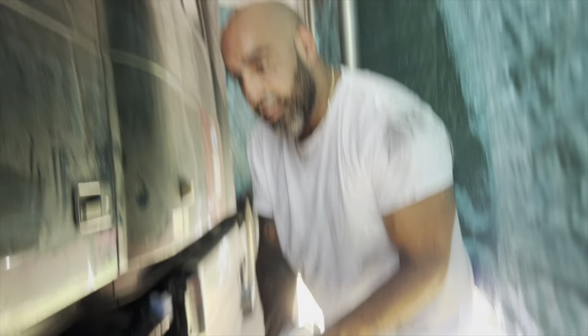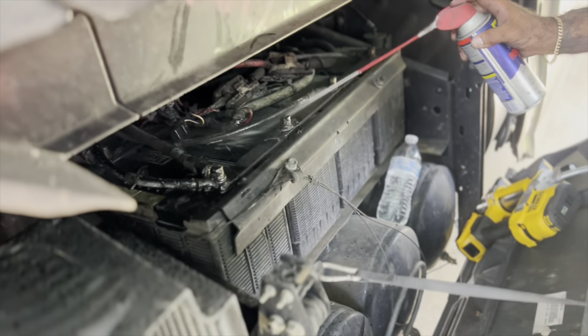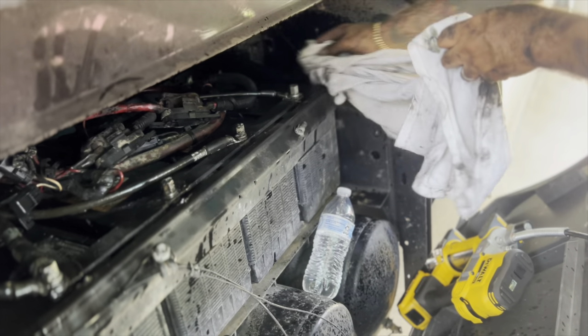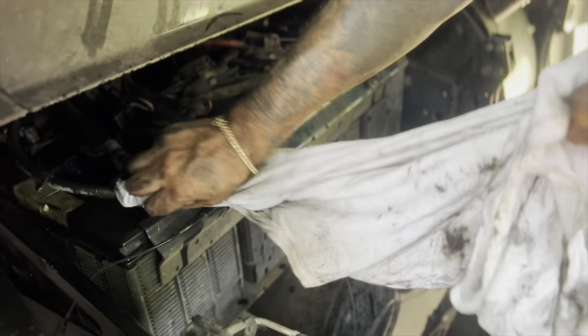All right, so the battery is something I like to do as well. Right here — the terminals — clean them off. Let that work in. You see that? It's good to hit that up. Sometimes you think you're having battery problems but the batteries are dirty — that's the problem. See that? Nice and clean, there's no corrosion either. You do this to your truck, you'll have less issues, I promise you.